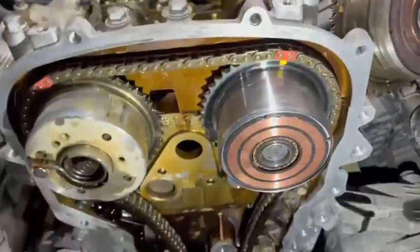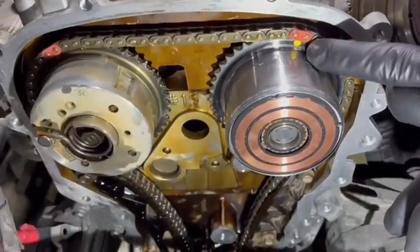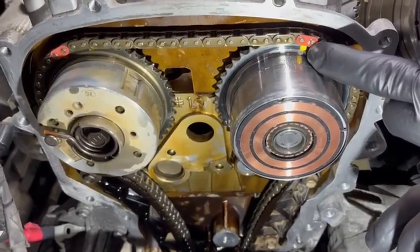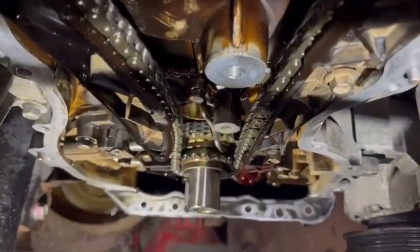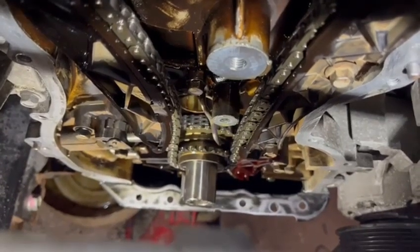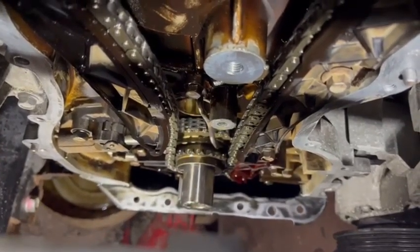Hi, it's Mark, Urban Automotive, Oakville, Ontario, Canada. Part 2, Phase 2. We're going to show you what I've done here. I've removed the cover and I've replaced the sprocket. As you can see, I've lined up the chain with the big yellow dot. The chain marks up also over there, and these lines line up with the top of the valve cover here, as they're supposed to be. And then if we can just get the camera down there on the crank, there's also lined up at the bottom. There's a special colored link on the chain.